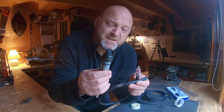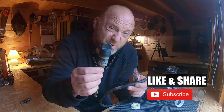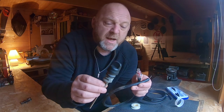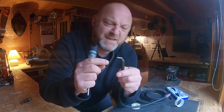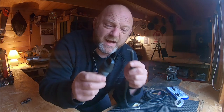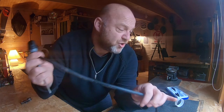This is the dipstick from the Harley Davidson Sport Glide Softail. What I did initially - unfortunately I've bent it - but I put a bicycle valve in there, drilled it in, stuck it in, with a bit of tubing with a kind of fuel filter catch can, and basically it was working.